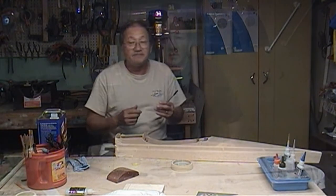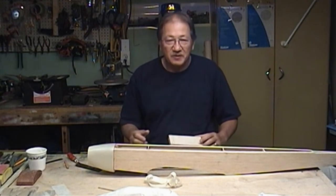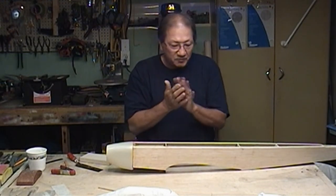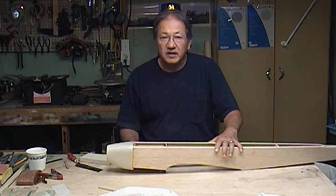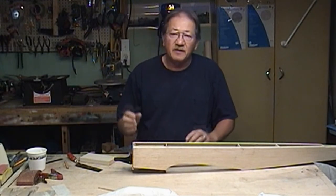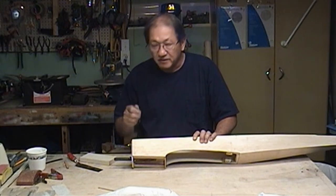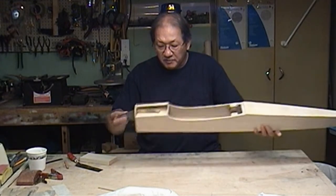It's been just a little bit more than 10 hours since I've been working on this. I took the tape and clamps off the firewall and test fitted my cowl just to make sure everything's going to fit. I found that my motor mount was in the way a little bit, so I took it off and ground it down on the belt sander — just rounded it off a bit, not a big deal. That puts us back to where we were.